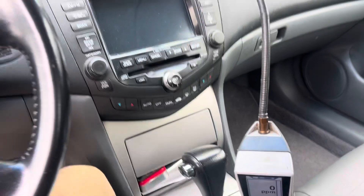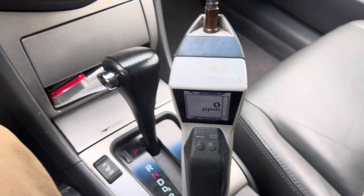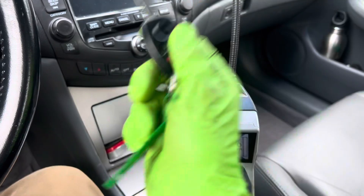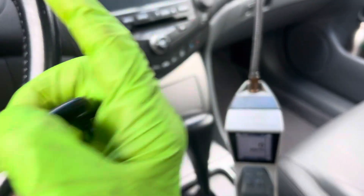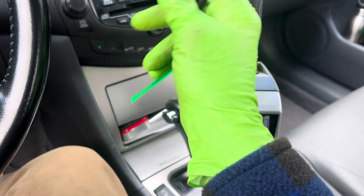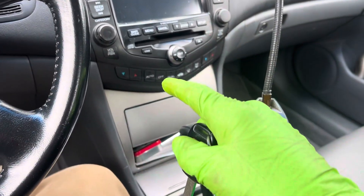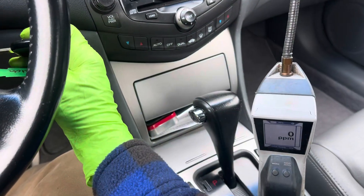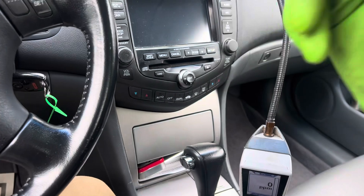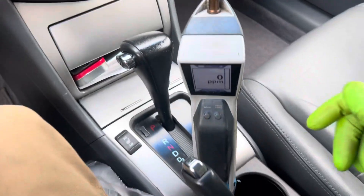This is your only chance to find an extremely small leak in the evaporator box. Where is it set at right now? It's not manual controls. So when you get into a car, if you did move it or first pull it in and you suspect a leak, set the vehicle where it's in recycle, it's in the face mode, and it's on the lowest speed. When you just turn on the accessory, it blows a little air. If it blows too much air, it can flush it out with fresh clean air and remove the refrigerant, and your leak detector never picks it up.